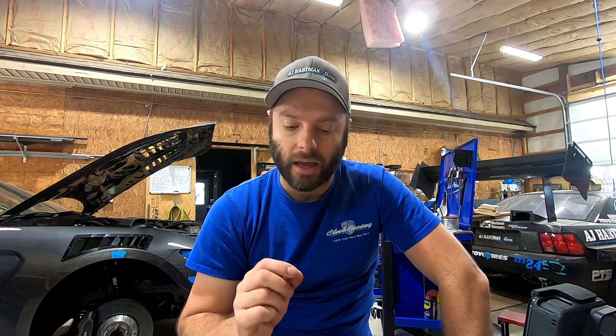Even though the original hood picked up 20 pounds of downforce over the stock blank hood, Race Louvers picked up 26 pounds — a good gain. As we've shown in previous wind tunnel videos, with pressure probes in front of and behind the radiator, there was also a little bit of cooling capacity improvement. Al Watson at Race Louvers does a really good job updating his website with data, so I'll put a link below to the Subaru louver page.